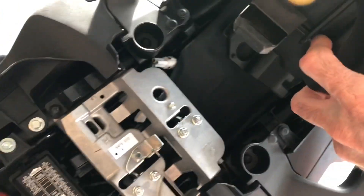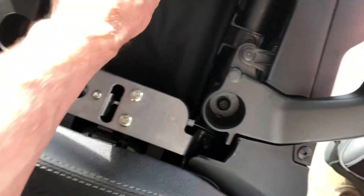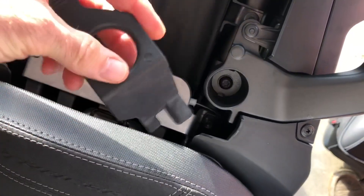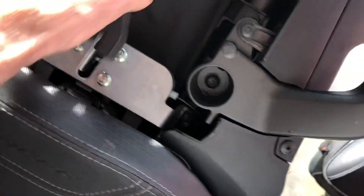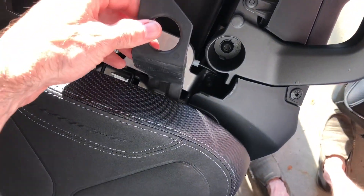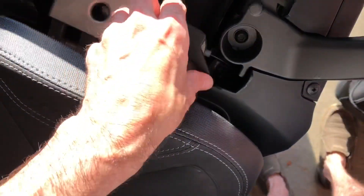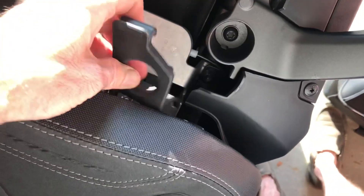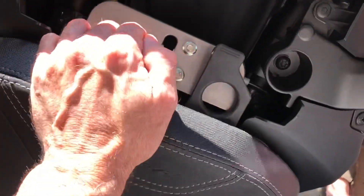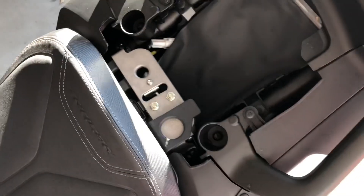To put it back in, take this clip and stick it in, then press back down — it's pretty firm to get it to click again. Once you get that click, you have to put the rubber piece back in. It might be a bit tricky. What I do is put it in just loosely — you don't want to stick it all the way in because it prevents that little lever from moving. You can see where the lever goes in that little gap. Just put it in loosely, let it clip, and then put the rubber piece back in. Then put the rear seat back on and you're all set.